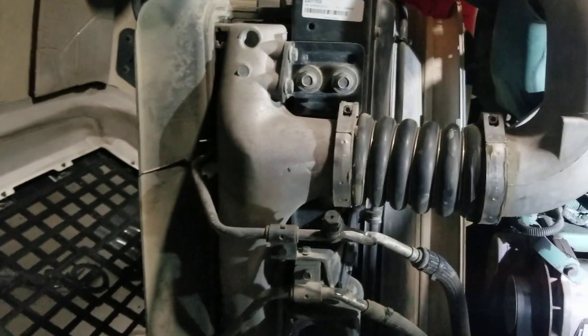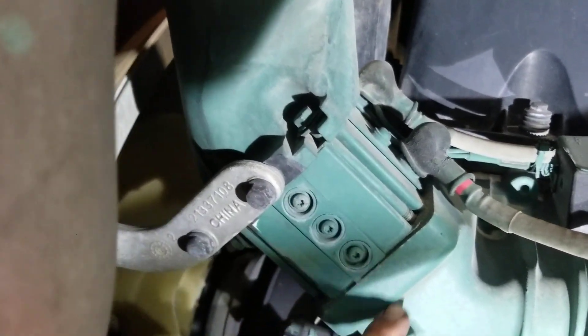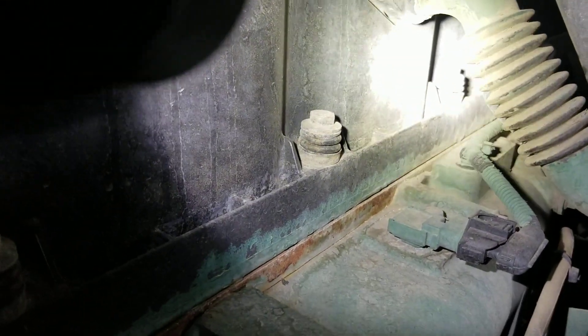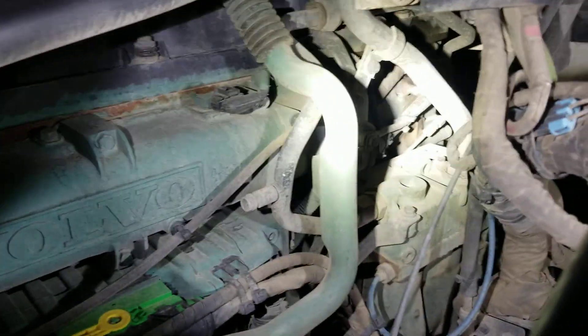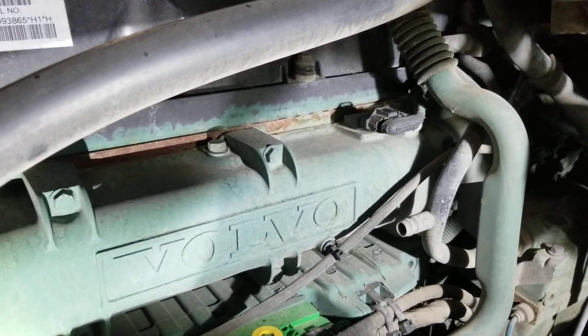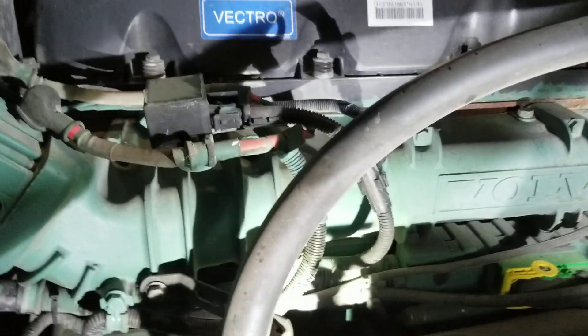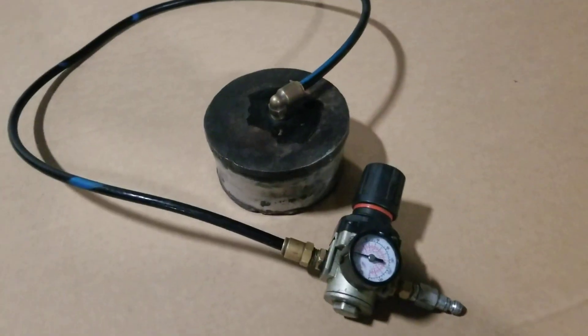Right where it rolls to the side, then go through all these pipes — this clamp here, this clamp on rubber pipes, intake preheater. There are two gaskets here and the intake manifold. On the intake manifold it's very common and it leaks in the back — that's if you have had a boost leak for a very long time and the back normally cracks there. That's if it's a very bad leak.